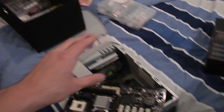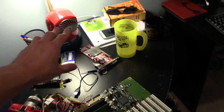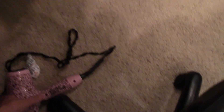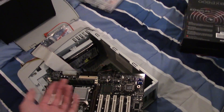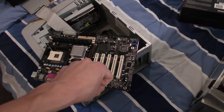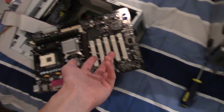Not really sure what happened. Either the power supply killed it — I can't really think of another reason to be honest, because this did have sufficient time to dry. Trust me — I had it on a fan for 5 hours on my desk, blowing out all the water. I swapped it around every hour so it would get the different side. And then right before I put everything together, I took a blow dryer — the same blow dryer under my chair that I used to get the CPU loose — and dried everything out. I held it up, didn't hold it too close because that might cause damage. Probably did this for about 5 minutes. And I plugged the board in, and it was just dead. So that was my procedure.